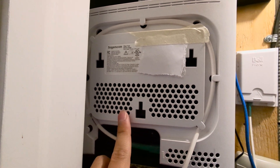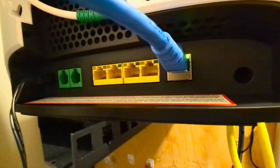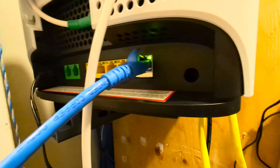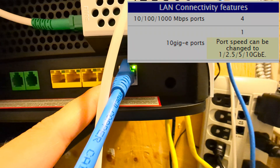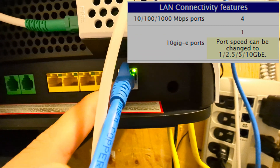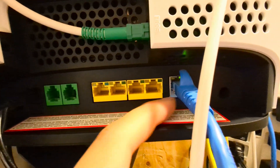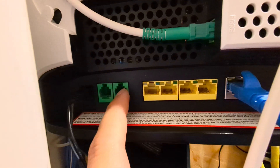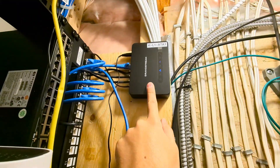You get your wall mount bracket — I think it's in the box, I haven't looked. You have your serial number, your MAC address, and your 10-gigabit Ethernet port right here — I currently have my pfSense box connected to it. It's also backwards compatible with slower speeds: 5G, 2.5G, and 1G. You also get your 1-gigabit LAN ports, which are also 1/10 I believe, and then you get your phone jacks — if you have an old phone or you can connect your whole house to an ATA adapter.